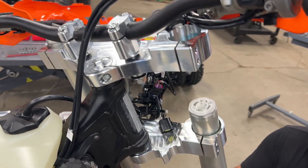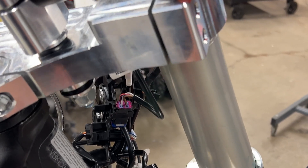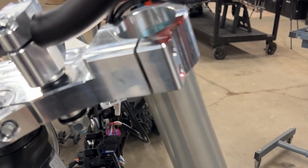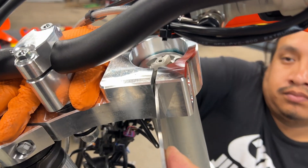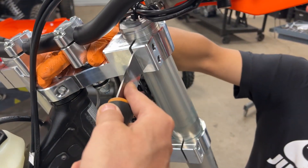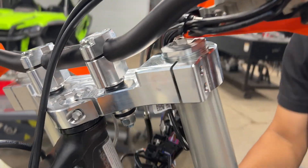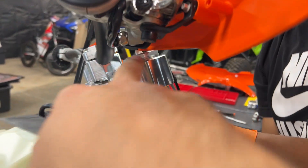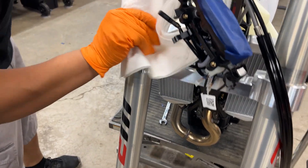When you're sliding the fork in, we like to put a little bit of grease in the triple clamp. We make these a super tight tolerance because we do not want floppy triple clamps and loose tolerances. When you go to slide it up, push it against your steering stop and rotate your fork towards the steering stop. We're going to go to the second line. Check clearances — I'm going to adjust the handlebars after. Move that hand guard, give it a little bit of a gap, and your next step is basically getting your fork centered up on each side. Go ahead and wipe the grease off.